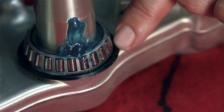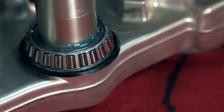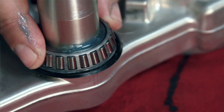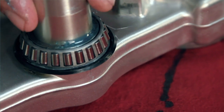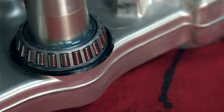Once you see the grease coming out, just clean up with a rag and take away all the excess. It is not necessary to have grease all on the stem — I see a lot of people do that. It only rides on this bearing, on that face, and on the other bearing, right on those two races that are inside the steering stem. So again, you do not need grease all on the stem. Once you clean it up, put it back in the bike and you're ready to go.